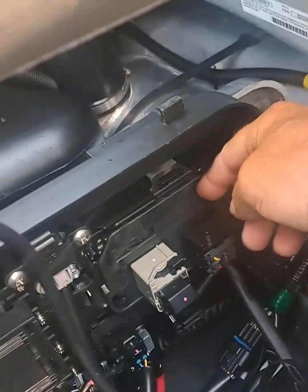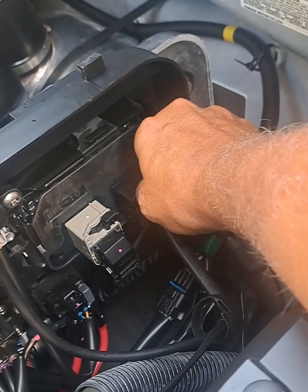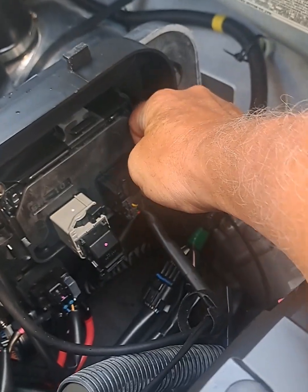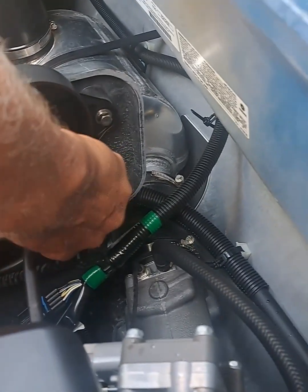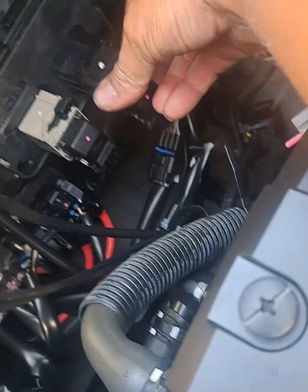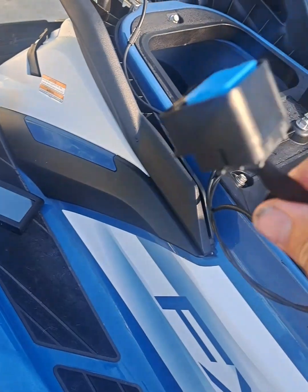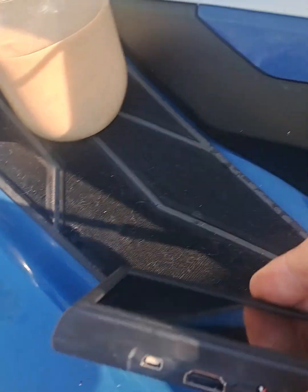So I have it hooked up, and down here is your ECU. This is the MAP tuner plug. There's a clip — you pull the clip, this is the factory clip right here. You take the factory clip off this side, and this is your wire harness that comes with your MAP Tuner X. It connects to the battery with two alligator clips, and then you've got this HDMI that will plug in right there.